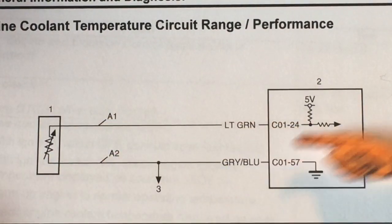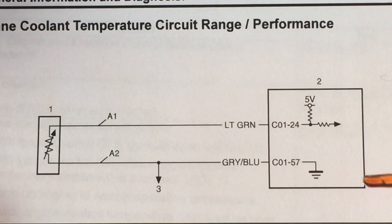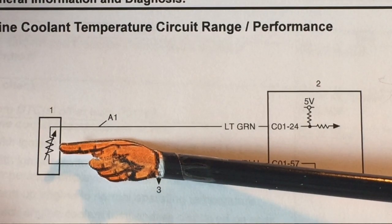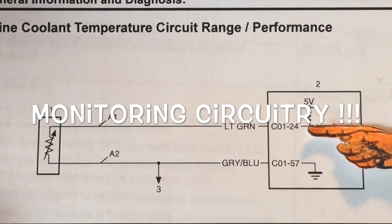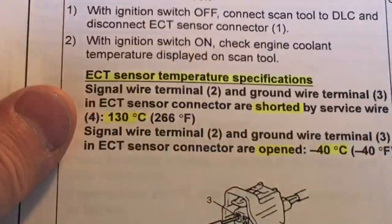Because if you look at the circuit, that's exactly what it is — you've got the current-limiting resistor on the top side, the sensing element (the engine coolant temp sensor itself), and then it goes directly to ground. As the resistance varies in the engine coolant temp sensor, the voltage picked up by the sensing element at this particular point would vary, and that's how the ECM can establish what the engine coolant temperature actually is.